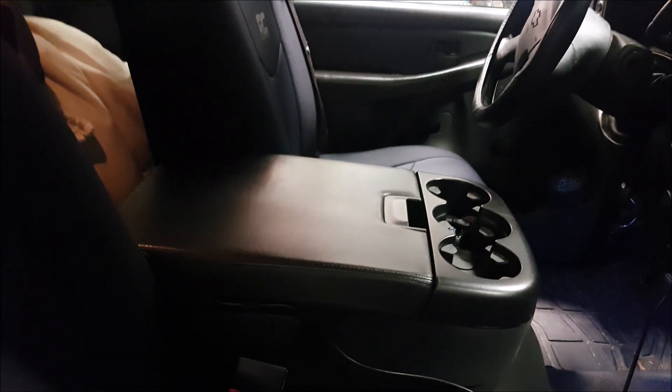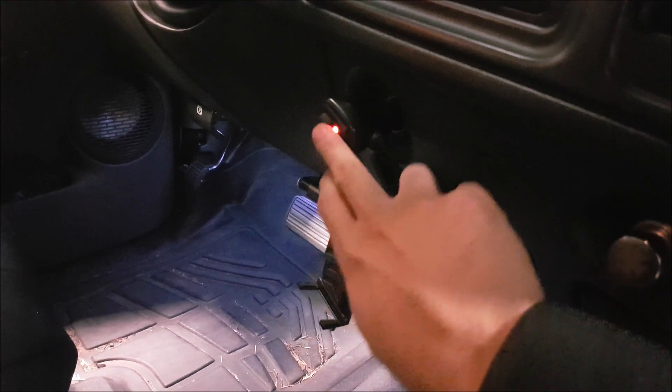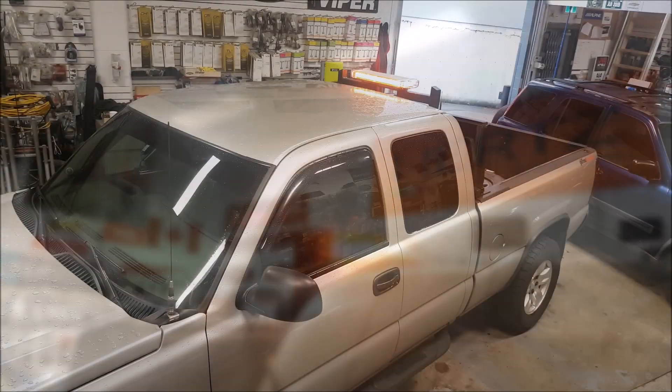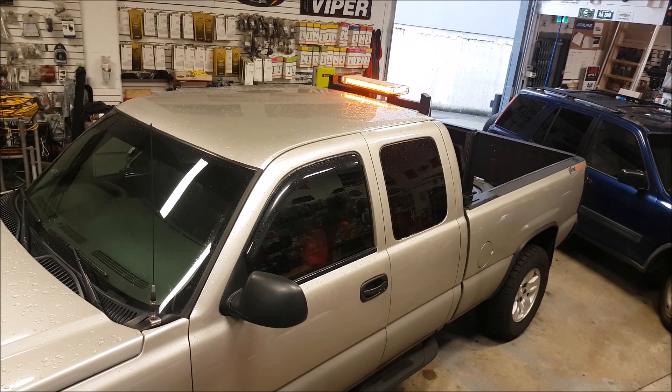So these are things I want you guys to consider. In this case, you close the door — it doesn't pinch the wire because there's lots of weather stripping in there. Then you run it across and it's over here at our power port, so we have lots of access to it. This one's always on, so we can turn it on and then we hit our momentary switch to turn on our first pattern.